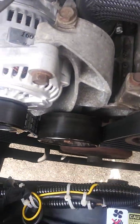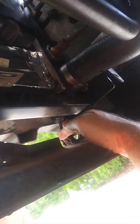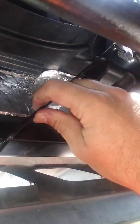And then underneath I've got, I think it's a Kevin's Off-Road lower radiator mount, this piece right here. That gives me a place that I can hook up my rescue points. So I've got a wire strapped around that and secured with a plastic rivet on each side, and it's holding the fan against the radiator. It's working out okay so far. I'm probably going to have to do something to strengthen up the connection points here, because that plastic rivet's probably going to fail. But by and large, I think this wire is going to do the trick.